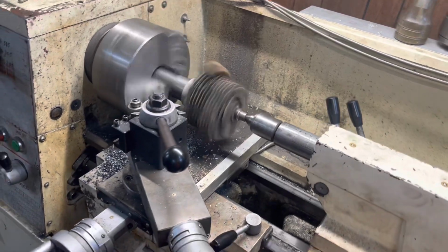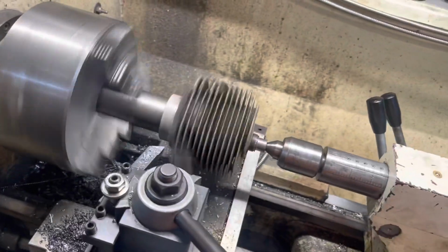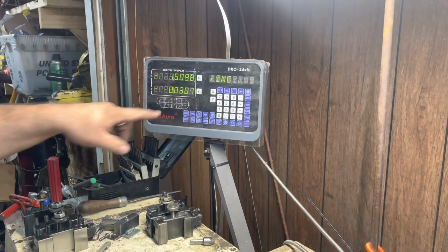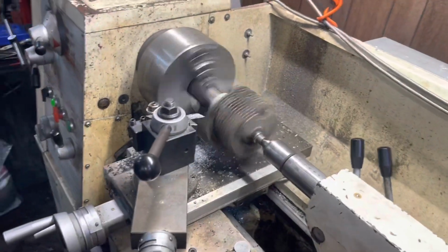Alright guys, we got the 2101 cylinder over here at Bellhoppers, and got him to cut the base for us. We're at 30 thousandths cut right now. We're gonna take 40 off of it. So film the other part.